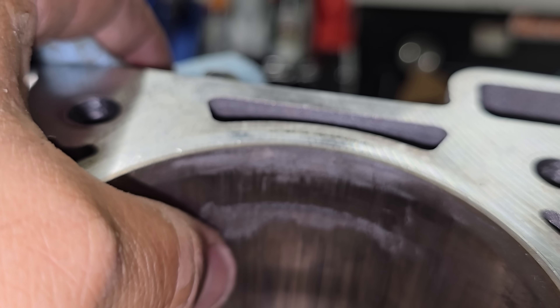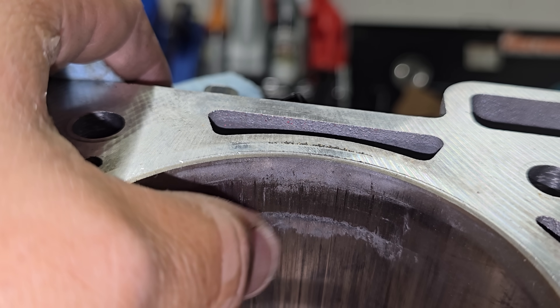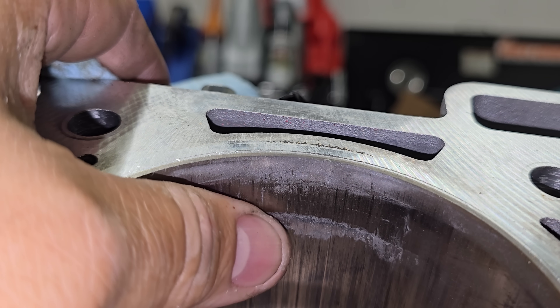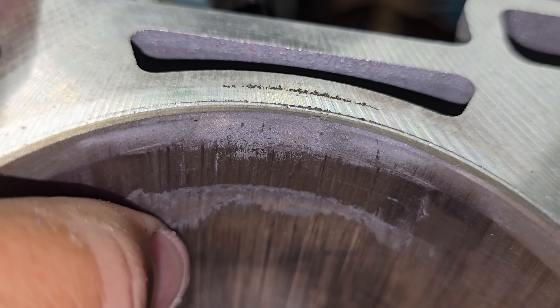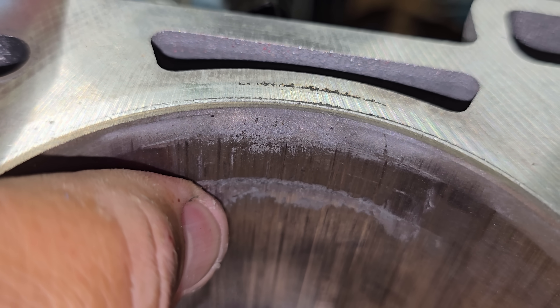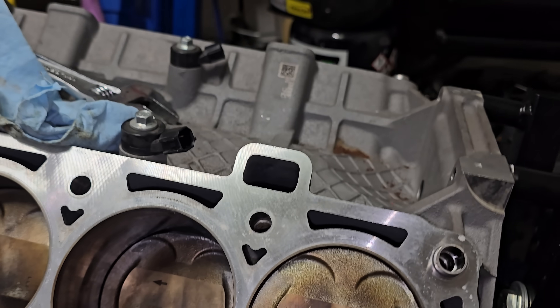This is a no-go right here. I think this engine is probably going to end up being a no-go, or at least this sleeve — and I'm not looking to sleeve anything. Look at how porous it is. Not a great short block candidate to mess with, but I did get good cylinder heads out of it. It'll be good to learn what a ring land failure looks like. I could have it sleeved, but then you start adding up costs.